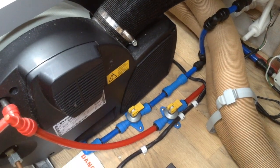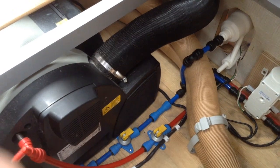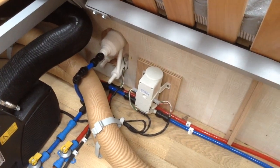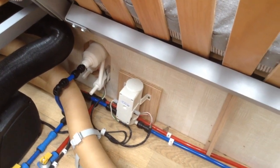It is important in the winter when you drain them out, and also when you're towing, you should drain them, but lift them both up into the vertical position and that'll drain your water out. Okay. You've got a solenoid over there monitoring the water pressure. There's no pressure adjustment for the caravan as far as the water goes.